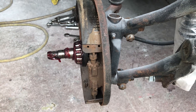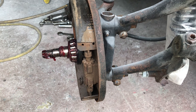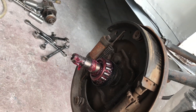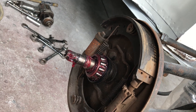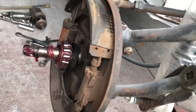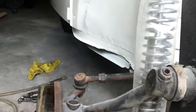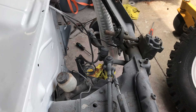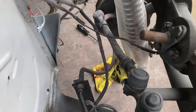Here we are back on the Baja doing a little brake inspection and we didn't find anything good in here. We need some brakes — there's no material left on the shoes. We have that wheel cylinder on the driver's side, and we have two bent tie rods. I don't know if you can see that, but one's pretty bent.